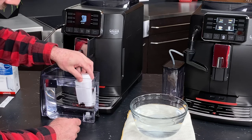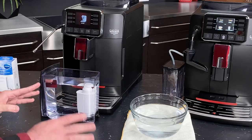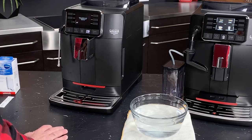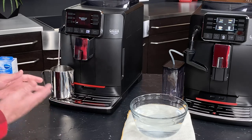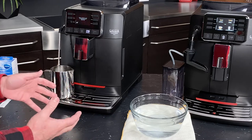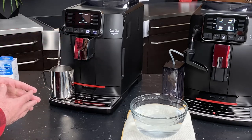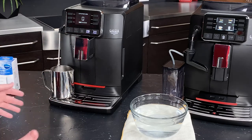Simply line up your filter with the water inlet socket and push down. If you're worried about your fingers getting in the water — we're about to drain this entire tank and refill it anyway. Add the reservoir back into the machine and confirm we're ready. Fill and insert the water tank — we already did that. Now place a container under the steam tube. You're going to need a fairly large container, something like a two- to three-cup measuring cup or a bigger bowl so we can get all the water out. Press the check and the machine will draw water in with the filter installed to make sure it can successfully prime. We have a progress bar here, and if you don't have enough water in the reservoir, you can simply remove it, add a little bit more, and you'll be able to resume the process without starting all the way over.